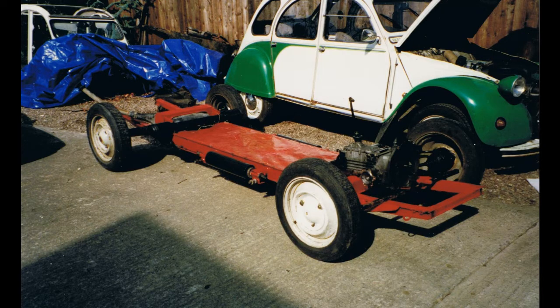The first thing when you're building an electric 2CV is you'll need a good chassis. The chassis I've got here was a genuine Citroen PO type chassis, a replacement chassis that had been hot dip galvanised by the guy I bought it off in Liverpool in the late 80s. It was in perfect condition but a little ripply on the flat panels because of the heat distortion. It was really a good chassis, painted red, and was probably the best chassis I've ever had. Because of the extra weight, it was a perfect foundation for an electric 2CV.